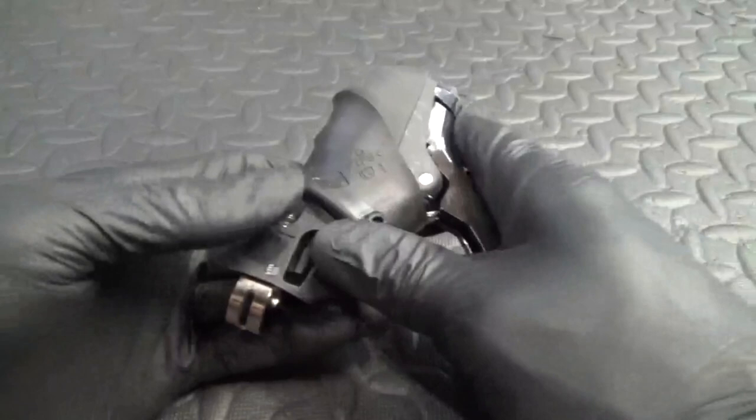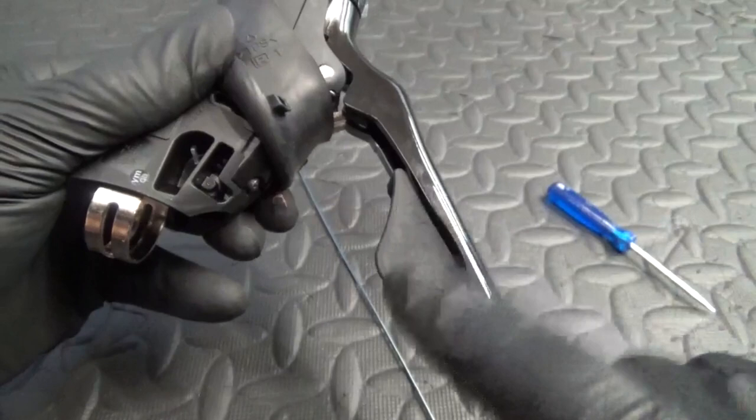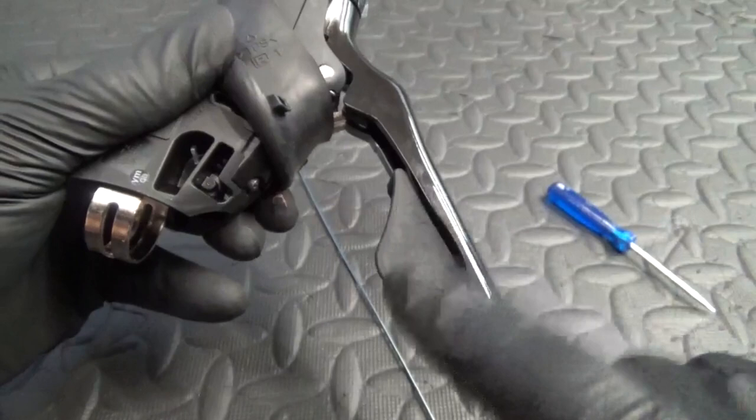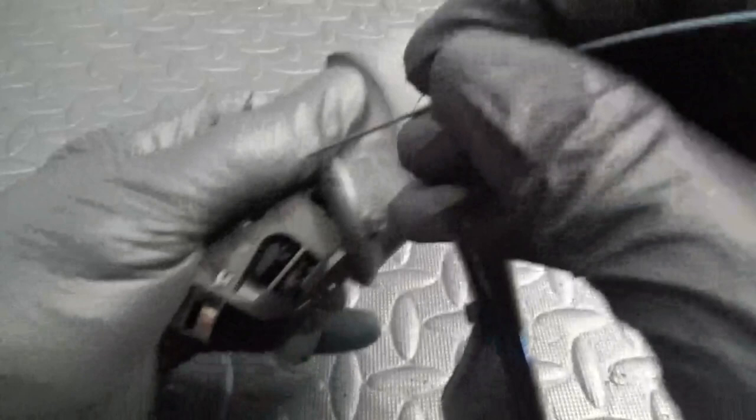Turn it round to the outside and push the hood back. There's an elongated slot there you can see. Now, find the end of your shift cable. Make sure that your shifter is shifted down to the smallest cog at the back — your 11-tooth. Otherwise the cable won't pass through the shifter body.